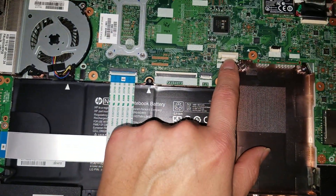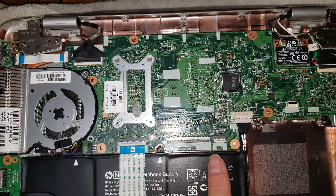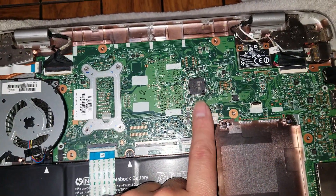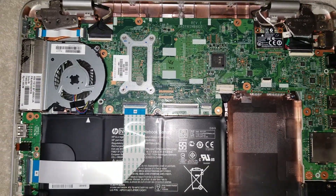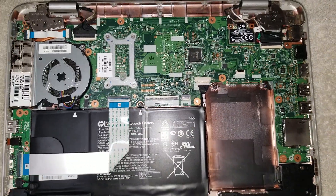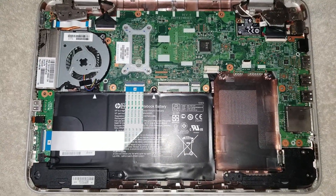Make sure the battery is connected. Once you power it on — especially if you changed the RAM — it's a good idea to leave the screws out for testing first. If you didn't seat the RAM correctly, have an incompatible model, or have a faulty stick, it won't boot or will beep at you. That's pretty much it — leave a comment below if you have any questions.